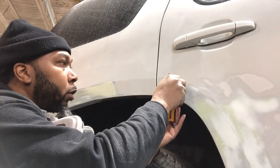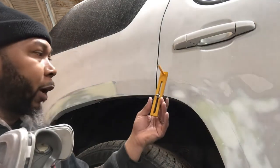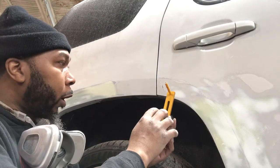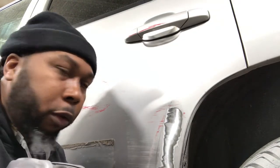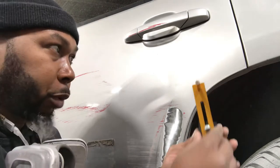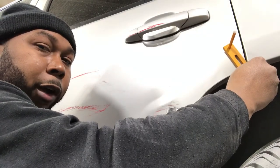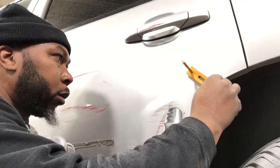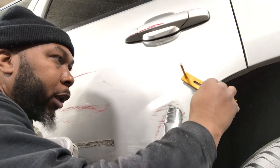Then you can trace. Now that you've reached where you need the body line and how you need it, adjust it to recreate the other body line. You can take it back to the damaged side and recreate that line. So now we're back on the damaged side. The body line tool is already locked in position — we just move it to this side. You trace the line going down the panel, and it gives you a guide of where your body line is from the opposite side.